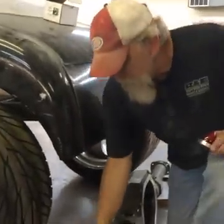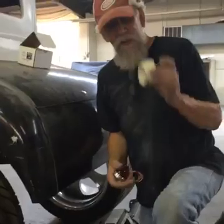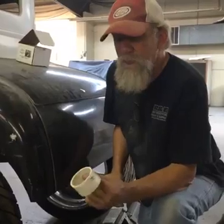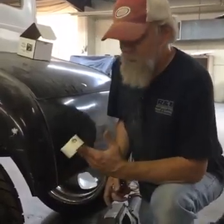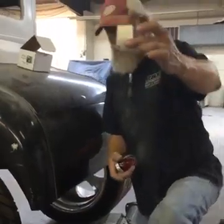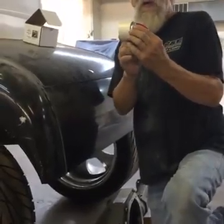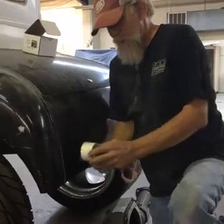What we're going to do, just like the old days, if I was going to French a car with metal, I would take a metal tube, cut it, weld it into the car, finish around it. With fiberglass, PVC works really well, and we've got some bonding materials that when we stick this on the car, it will not come off. Now, if you can see, I've got an angle on it. The angle will be like this. I want this light to be 90 degrees to the ground. I don't want the light angling up like that if I put it in.